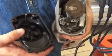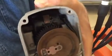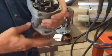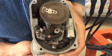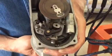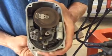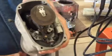And this one, you can see one of these nasty old tar wrapped coils. Those most times are probably needing replacement. I'm not sure if we can see points opening and closing, but that is when the spark is going to happen, is when the points open. As soon as the points open, that's when the spark happens, and then this has to be pointed at one of the leads in the cap to get the spark to the proper spark plug.